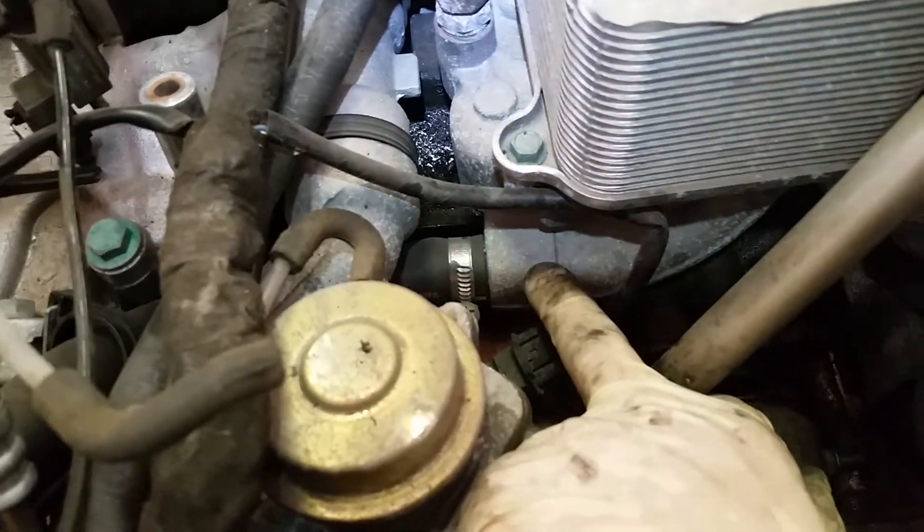Fixing to do this one — that's three, four, five, six, seven — right there. You've got to pull the power steering pump to get to it. And then eight — this is the one that nobody gets — it's underneath the intake, you can't hardly get to it. So eight pipes total, not six.